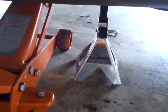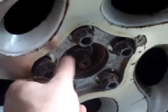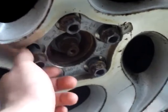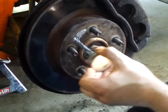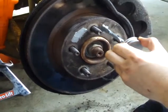Make sure you include your safety jack stand as well as the jack. Next take off all five lug nuts. You may have to kick the wheel or the tire to get it to come off because sometimes they get rusted on. I want to put a little bit of anti-seize where the wheel meets the rotor just so it doesn't get corroded on there. I'll do that all the way around.